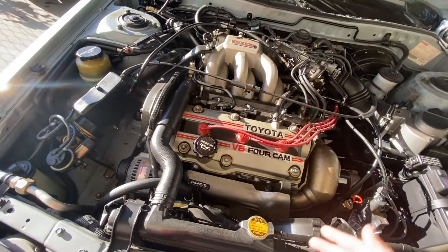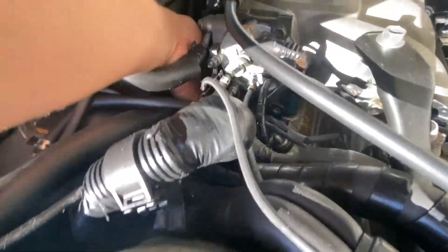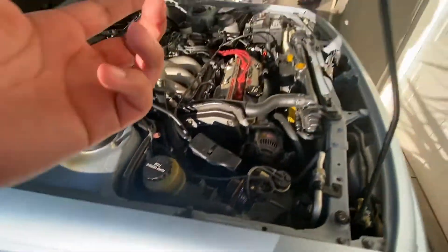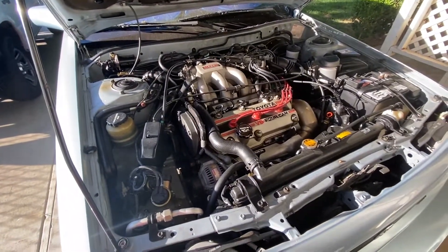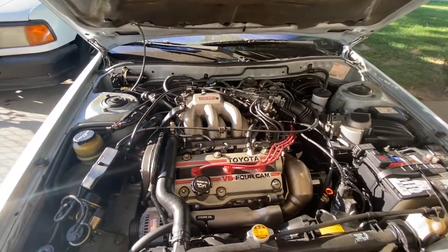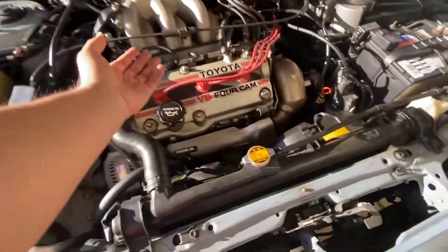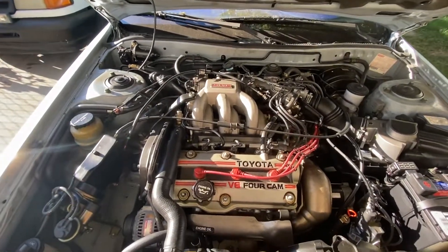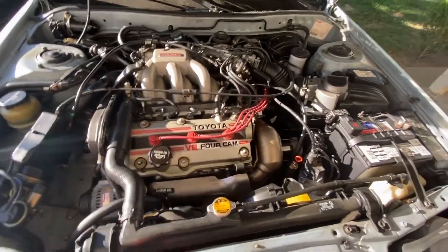This part is gonna be a super quick job including the wiring. The back ones — it's really easy to get to them if I didn't have to do the manifold. I just need to take out this hose, this hose, and then I can get my hand back here and do the three spark plugs. But since I have to do the valve cover gasket first, I've gotta take care of everything else on top. Once that's removed it'll be really easy to do everything, including the spark plugs and the cables — just extra work.